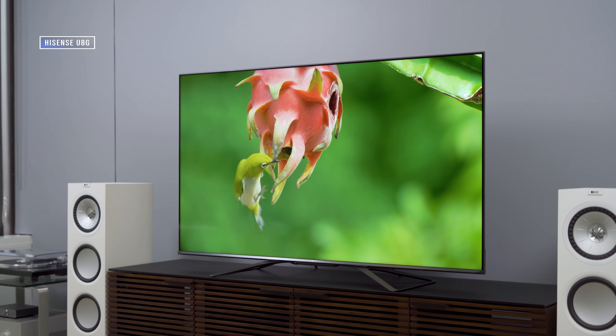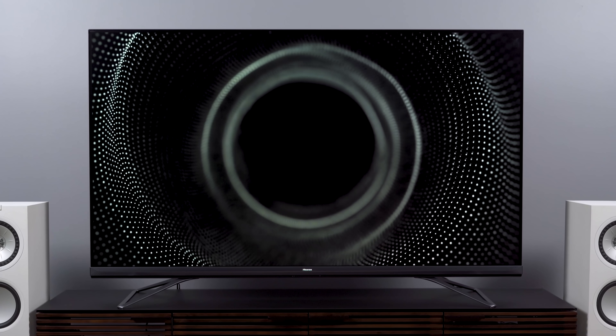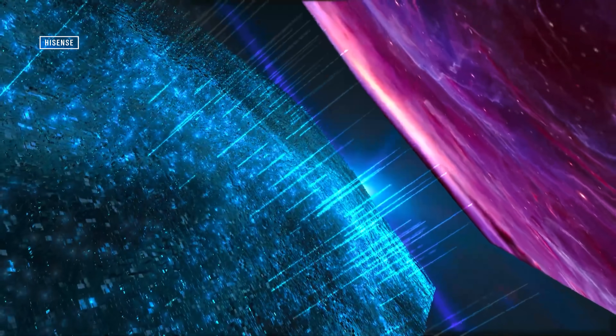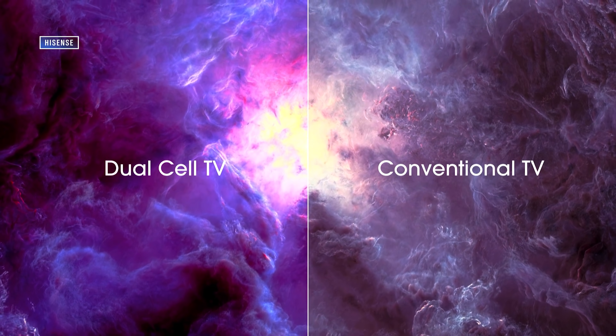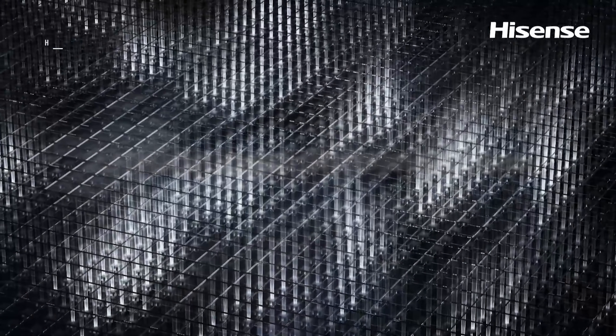That light passes through a bunch of layers including an LCD layer with color filter, and voila — picture on your screen. A dual cell TV like the Hisense U9DG adds an LCD layer to act as backlight control. Instead of dimming and brightening the backlights directly, what you basically have is a black-and-white — or technically grayscale — LCD layer that controls the light going through the next color LCD layer. That grayscale layer is acting like a backlight control, and while it isn't pixel-per-pixel perfect, it is a 1080p layer with two million independent light-controlling pixels. This added layer of control is very promising for improving black levels and shadow detail while minimizing halo and blooming.